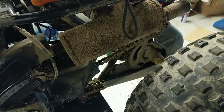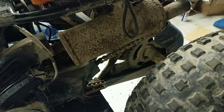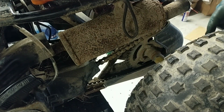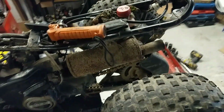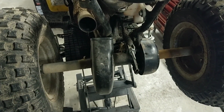This was actually in for non-starting. Now I'm going for a new carburetor for it. It's one of the cheap Chinese things that's on it. I'm getting the original. When I've got that off, I've got the chain and sprockets, and it's got to be the exhaust blowing. Get that done. I've got a new carburetor. I got it going, but the carburetor was flooding. Just cheap rubbish, honestly. Right, let's see what's first with this.